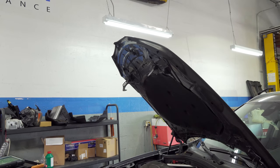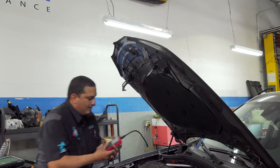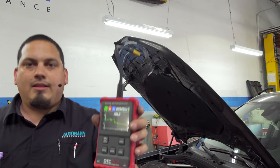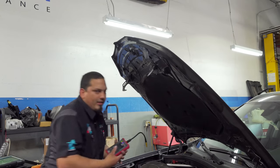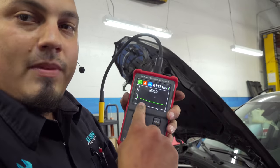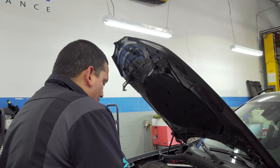This video is really to address the people who are saying, well, you could just swap the coil. Okay, you could swap the coil — yes, if it doesn't follow then you're going to swap the plug. And then this is a GDI — those of you who know about GDI BMW plugs, you don't reuse them. And then on top of that, you keep with the oh, let's swap this, let's swap that — yeah, it's fast, sometimes it's great. But you don't get an inside look into the cylinder. It may end up biting you in the back if you have a slightly lean condition — it might come back two or three months later and bite you. Because the lean condition is overworking the coil. So I swapped coils three and four, and I'm just going to take a quick look. My check engine light is off — it is not under cylinder deactivation. This is my number four. I may have gotten a one-off here, but that does not look lean at all. Let's get another one. That was a one-off — that does not look lean at all. Let's go to number three. Number three — no good. If for anything at all, you can use these tests to show: hey, listen, this waveform followed the coil.